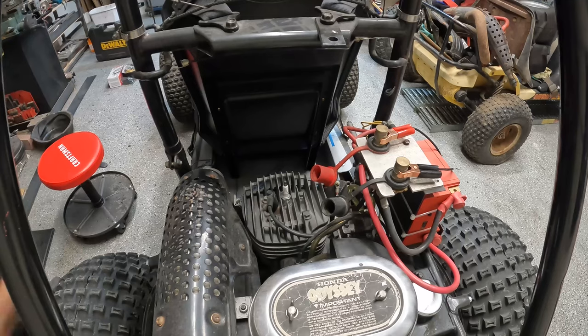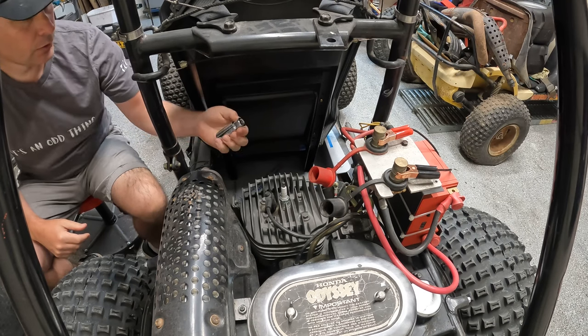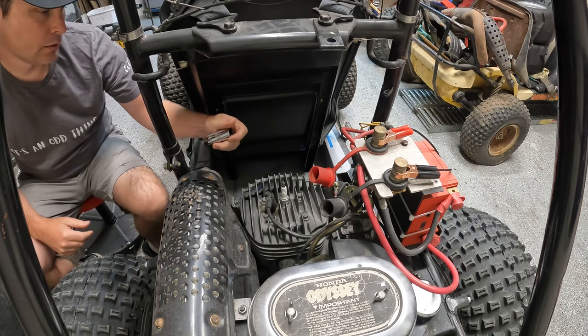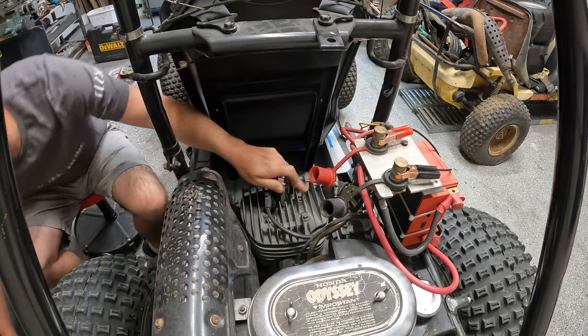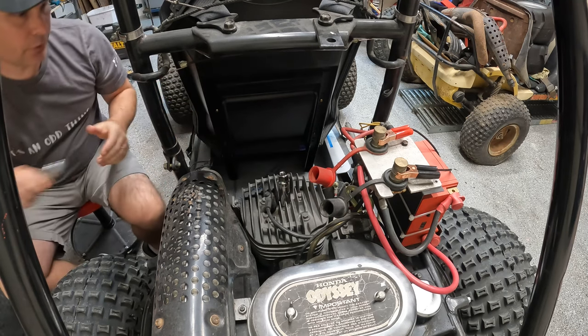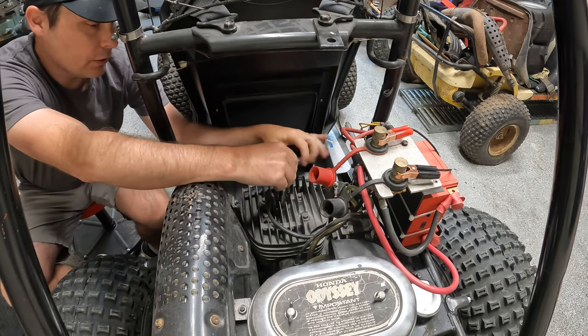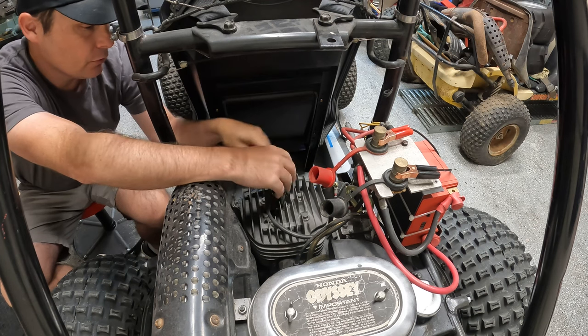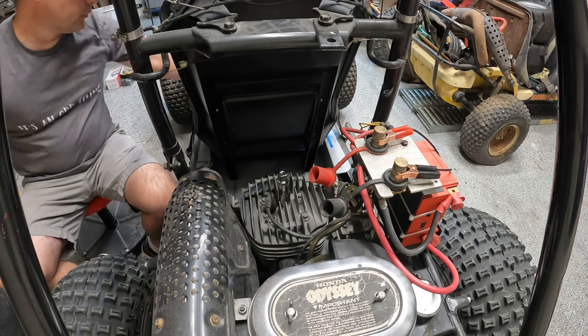I'm going to get the camera set up and just wire it up. It's not going to be a complicated process — just a little bit of wiring and it'll be good to go. So the first thing we're going to do is take the spark plug off, using my 13/16th socket — it's probably some millimeter socket in reality. So we're just going to take this off. Make sure that the top of your engine is clean and there's not a lot of gunk or anything that could fall into the spark plug hole. Just going to loosen that up.